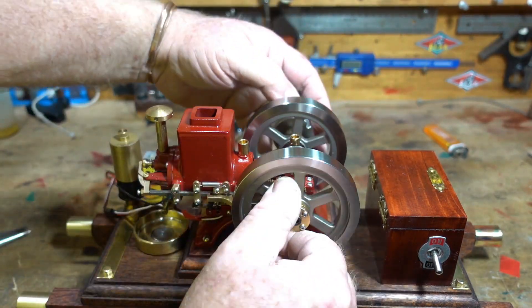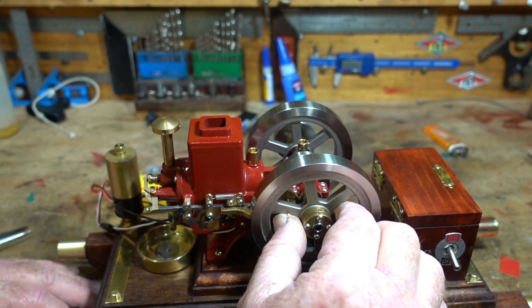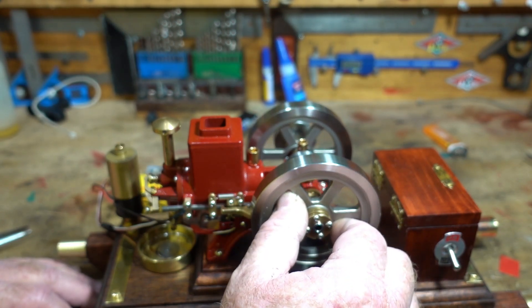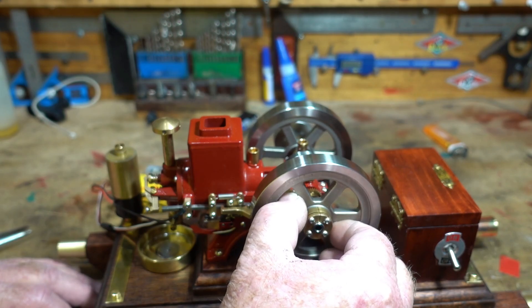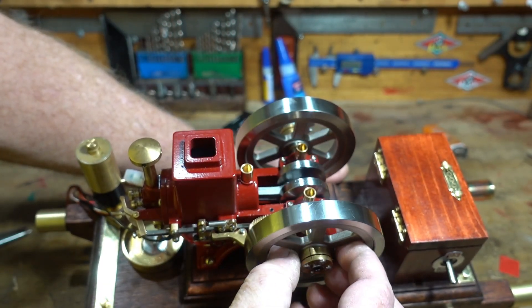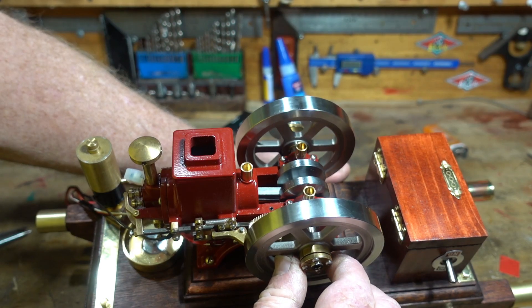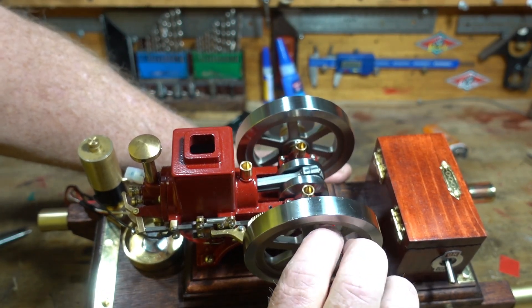There's compression there. That looks like that's bottom dead center now. It's coming up — no compression there. So definitely compression. Piston's going in. There's top dead center right there. I'll look this up to show you. Top dead center is right there. Starting to feel compression now — yep, just feel it in there, just feel that compression.